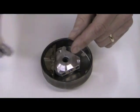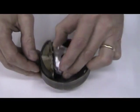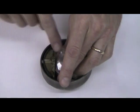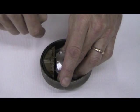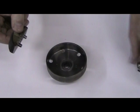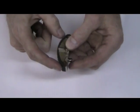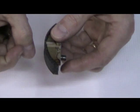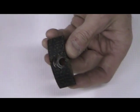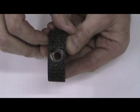We have our spring stack, but typically the first thing we have is drum wear. If the drum is oversized, the shoe will have to fly out further to make contact, which increases RPM engagement. If the shoe itself is worn on the shoe surface, it will have to fly out further, which increases pressure and causes higher engagement. If we have wear internally where the spring stack rests against, that can change spring pressures causing engagement changes.